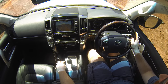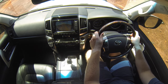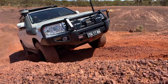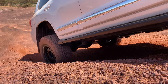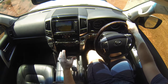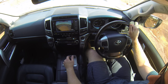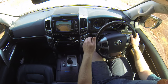Back at the base of the hill, we'll select crawl control at speed three out of five. We're in drive, foot off the pedals, and we'll just crawl up and see how far we get. And there we have it — nice and easy. That was a lot more controlled and a lot easier on the car than it was in rock mode. The great thing about crawl control is it also works downhill as a downhill descent control, so we'll use it at the second slower speed to hold us down the same hill.